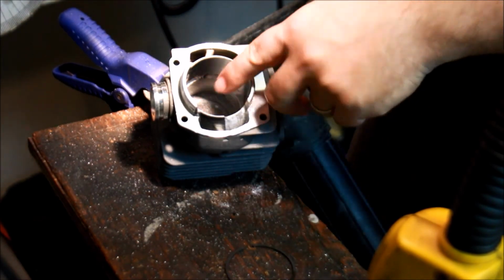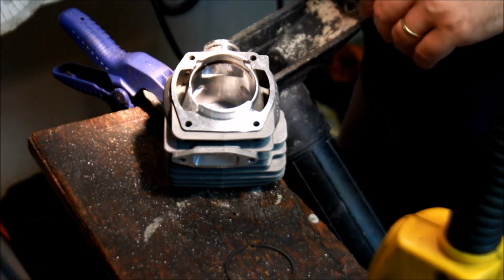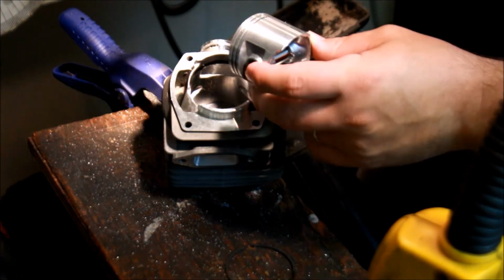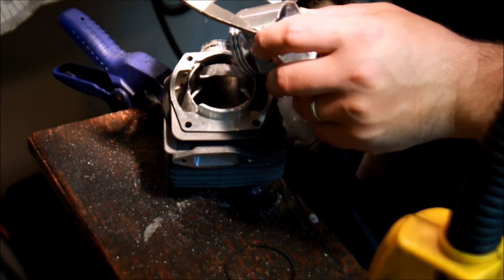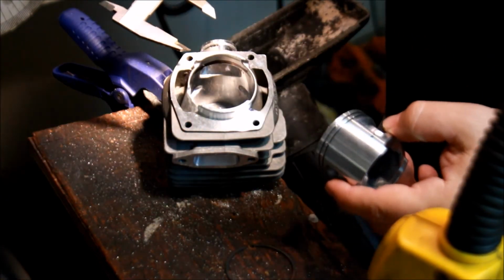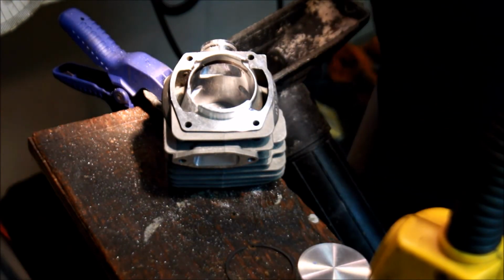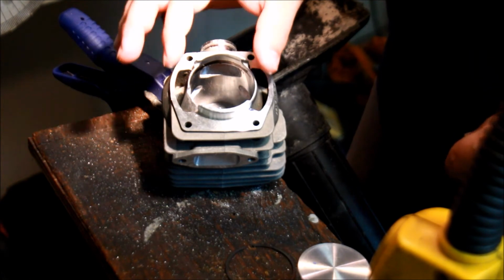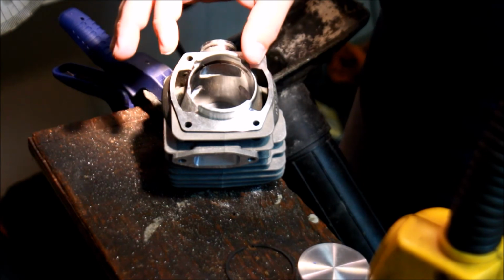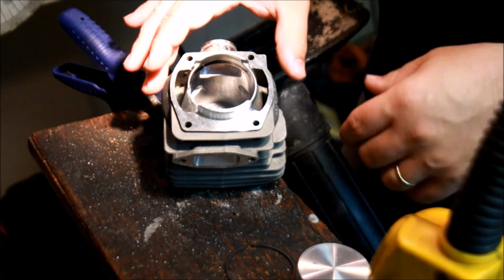So one of the questions is certainly going to be, how wide do you take the intake? Well, got to measure. That width right there. So you can just mark it, and what's nice is if you actually run a used piston cylinder, often there'll be a little bit of a rub. You'll know exactly where you don't want to extend to. A millimeter or two away from that rub mark is where you want to bring your intake to, for width anyway.